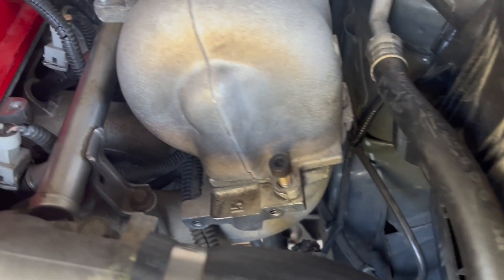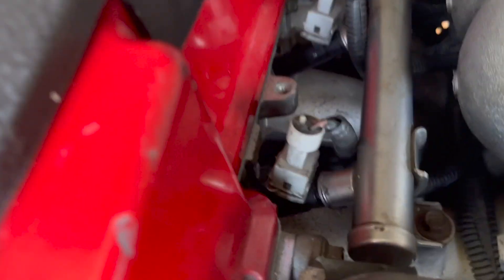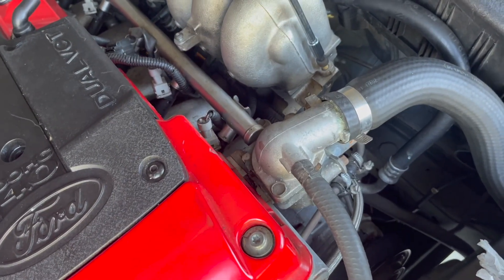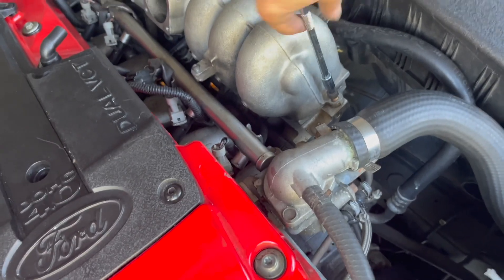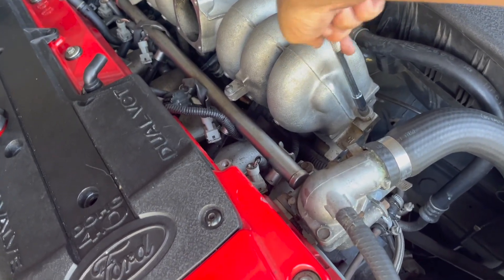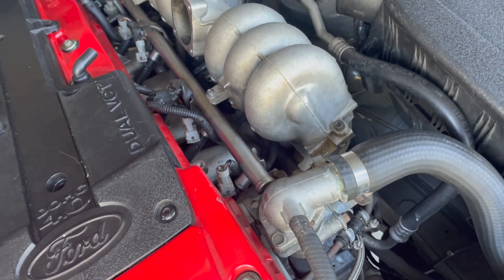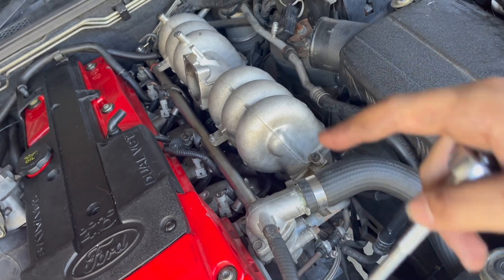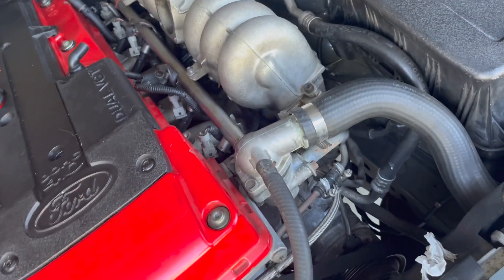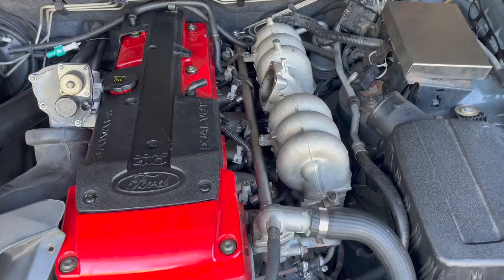For the top half, just line it up, put in two bolts, and pop it in — definitely not as hard as the actual intake manifold. I'm not putting Loctite on these bolts because these top half gaskets never really go bad, and this side doesn't experience as much heat. The torque rating I found online is 25 Newton meters — just nip them all up going in and out left to right, working towards the center.